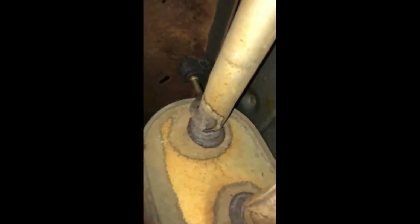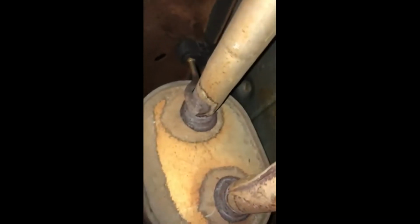The next thing we're going to do is heat up and try to remove the catalytic converters. So I'll show you. Here is one of the cats, and there's an O2 sensor, so that'd be the downstream O2 sensor. If you follow this, it goes back to the muffler. The pipe is separated all the way back to the muffler into two separate pipes, until it gets there, and then it comes out in the back. So I guess it wouldn't be too hard to put dual exhaust in here, but for now we're gonna focus on the O2 sensor that I tried.